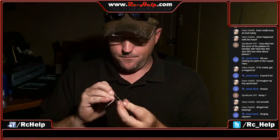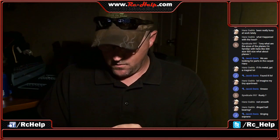So, guys, the bolts in the feathering shaft were threadlocked, so they wouldn't have come apart in the first few flights anyway. But because there's no grease, take it apart. Seriously. Okay. So we can get the feathering shaft. We can go ahead and pop that through here. We can put the bearing on here. And then we can put our spacer on here. Sing a soprano.